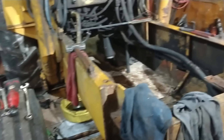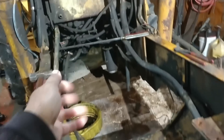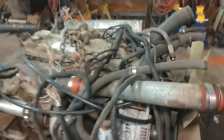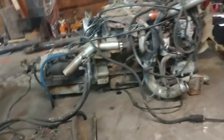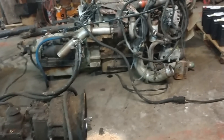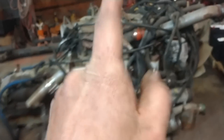I pulled the transmission out to fix that line, and as I'd been thinking about this — I got this hydraulic leak, I've got all these things to do underneath here — we're going to have the motor out, we're going to have the transmission out. I'm not putting that Detroit back in. Watch this: I'm going to pull this Cummins out. This is a 24-valve Cummins with an Allison AT545 — that is what we're going to try and shoehorn back in there. I've been doing measuring and measuring, and I think we can make it work.